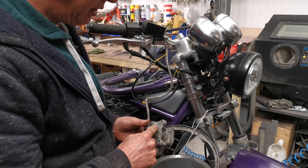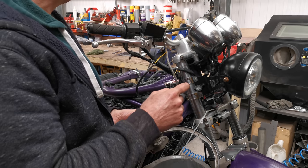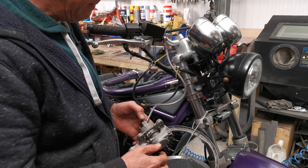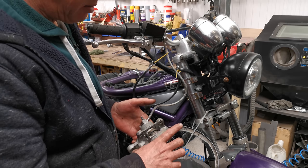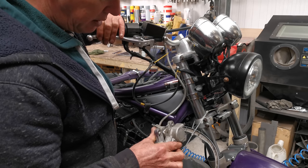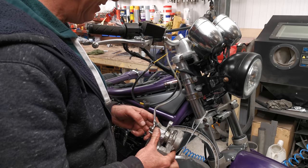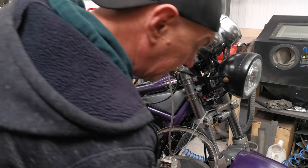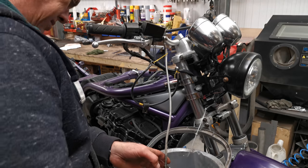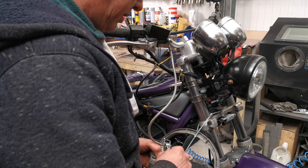There's a bleed nipple on either side, so what I might do is if I can get one of them out, I've got some spare steel - I'll make up a plate, bolt it with the O-ring in place so it's all sealed, and that'll bung up the holes. Then I should be able to hook it back up and pump the other one out. Right, we might get that one out - at least one of them's out and I can check the state of those pistons.